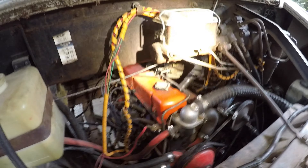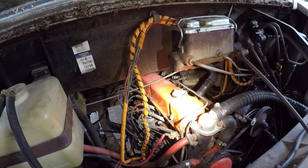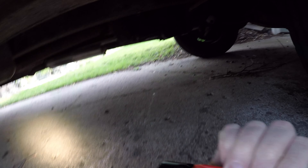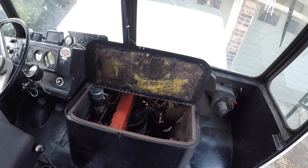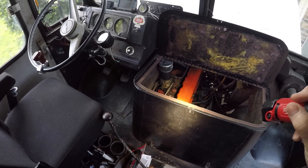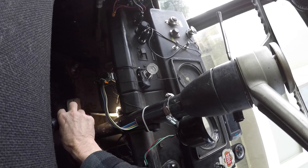When I put my V8 back in, that's going to fix that problem. The problem with the automatic transmission is I have an emergency brake on this vehicle — an e-brake — and I'll show you what I'm talking about. There's an e-brake right there. I'll be able to get rid of that clutch pedal, though I'll probably just leave it in there. But I also have to have a neutral safety switch, because the clutch pedal has a neutral safety switch on it underneath there.